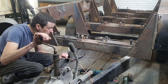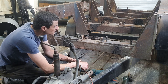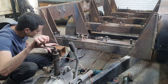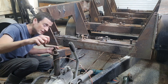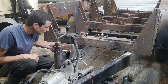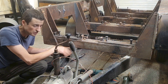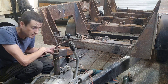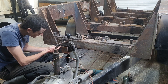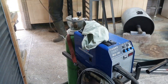The next thing to do is sort this gap out. I've got support between the frame and the trailer in six locations at the moment but I want two more at the front. It turns out when you wind this you can actually close this gap. That fits nicely — I can very easily wind the front of the trailer up and close that gap completely. So this is in fact quite a floppy trailer and the rolling road frame is actually offering the strength of the trailer. You can see there's a huge gap. So I'm going to chop that in half, weld one here to the underside of the rolling road frame on both sides, drill and put a bolt through there — same on that side.